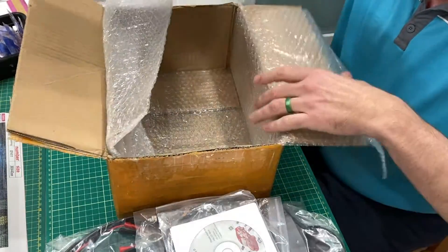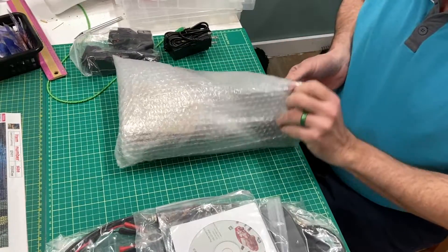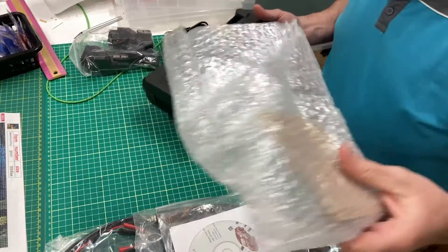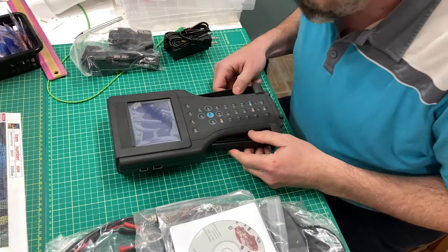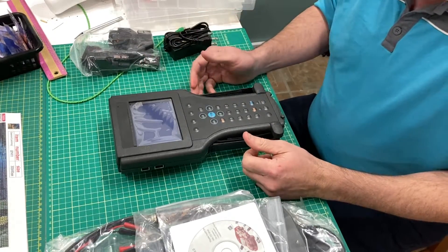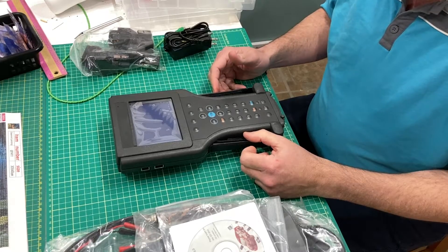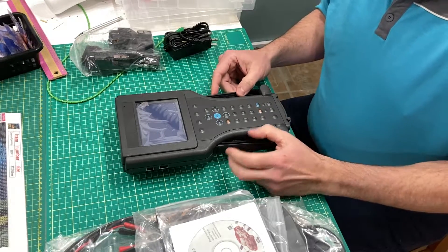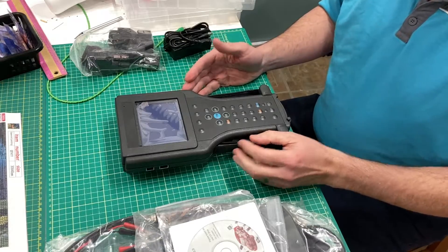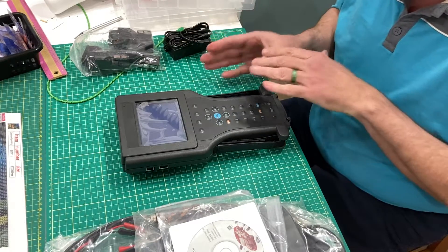I was not thinking this thing was going to be so big — that's it for the box. It's a lot bigger than I thought. Wrapped in lots of plastic wrap with a screen protector is the actual tool itself, which is fairly big. What this has over regular code readers is it actually has the ability to push data to the vehicle as well. Most OBD2 readers are for emissions — they'll do engine, but they won't do ABS, traction control, stability track, or tell you why your airbag light is on. This is the tool that can get into the body control modules — GM-specific, not covered by OBD2.